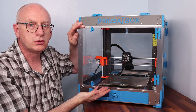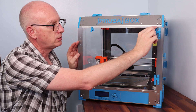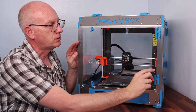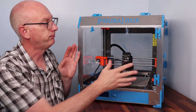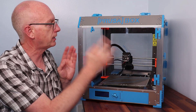When you're fitting the doors, just one extra thing: the holes for the hinges are at the top and then slightly midway up. So don't put the hinges on the wrong way around, as I happened to do initially. Just be aware there's a right way and a wrong way on the front and the rear door.